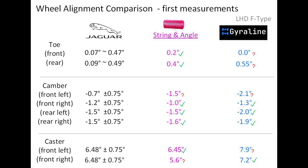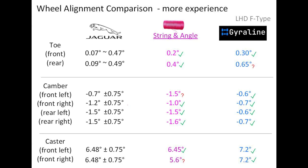Here's a comparison between the string-and-angle method and the GyroLine app on my iPhone 13 mini. The GyroLine results show a little more diversity in readings, with many falling outside the Jaguar specifications, suggesting the GyroLine thinks the car may be less aligned than it is. However, I found that after about 30 to 40 measurements, my experience level increased — handling the phone with gentle care when carrying it, and placing it on a foam surface to reduce impulse disruptions. That tended to give more consistent and accurate results, and in the 'more experience' table I was able to get much more consistent GyroLine readings.